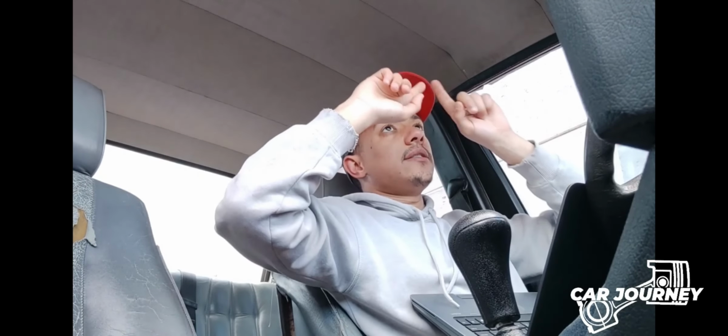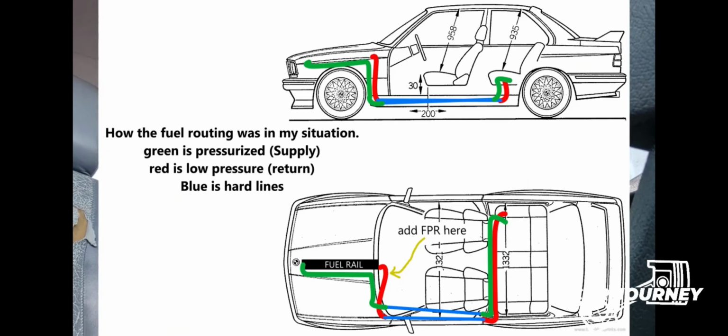And cycle it enough before it goes, like a daily thing. So how I found the direction was I looked at where the fuel filter was in the engine bay, like I showed in the footage, and I traced from the rubber line all the way through to the steel line, and I marked off which one. There are two fuel lines that sit there. So you have your fuel tank, I'll see if I can do it on the diagram. You have your fuel tank, you have your two lines. I marked off which one was the pressurized line where I need to put the filter, and then the return line. Then it was simple: taking yours off, putting yours on with clamps, and sending it back up to the tank.